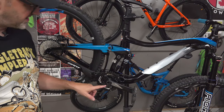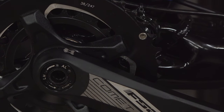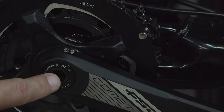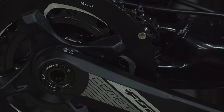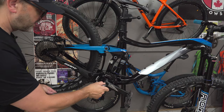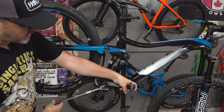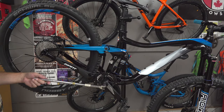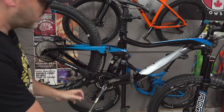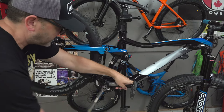Okay, so to remove this crank — if I just zoom in here — it's got a retention system. This ring here keeps pressure against the spindle, and as you crank out the internal bolt it pushes the crank out. You're going to go counterclockwise, so just put your 10 millimeter socket in here. Full disclosure, I've already gotten it loose but it is really on there tight, hence the need for a breaker bar. You should be able to crank it and pop it loose.